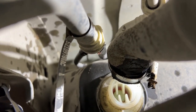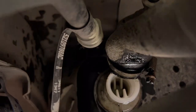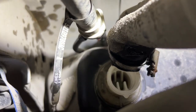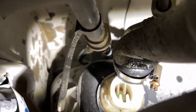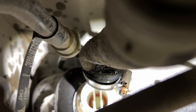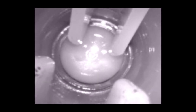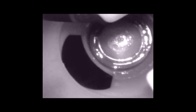There we can see just inside the tank — trying to get some light down in there. It's really hard to see anything. We'll try to free that valve up. You can definitely see where the check ball is in the closed position. With the camera in here, you can see I've freed things up with my little screwdriver inserted in there, and it seems to be functioning properly.